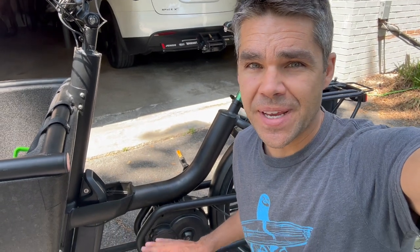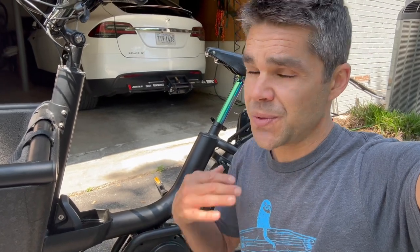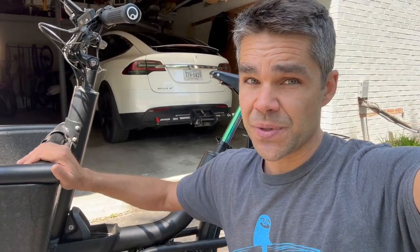The last upgrade — which you can't see but I'll link in the description — is the addition of a Speedbox speed controller. It's a little dongle that plugs in between the control on the bars and the motor unit. What it does is allow you to set a limitless pedal assist. By default this is a class 1 bike — pedal assist up to 20 mph — but with the Speedbox you get limitless pedal assist. As fast as you can spin those pedals and as fast as the drivetrain can turn, the bike will continue to output torque through the entire gear range. On USA roads, I've comfortably hit 32–33 miles per hour, and it is fantastic.